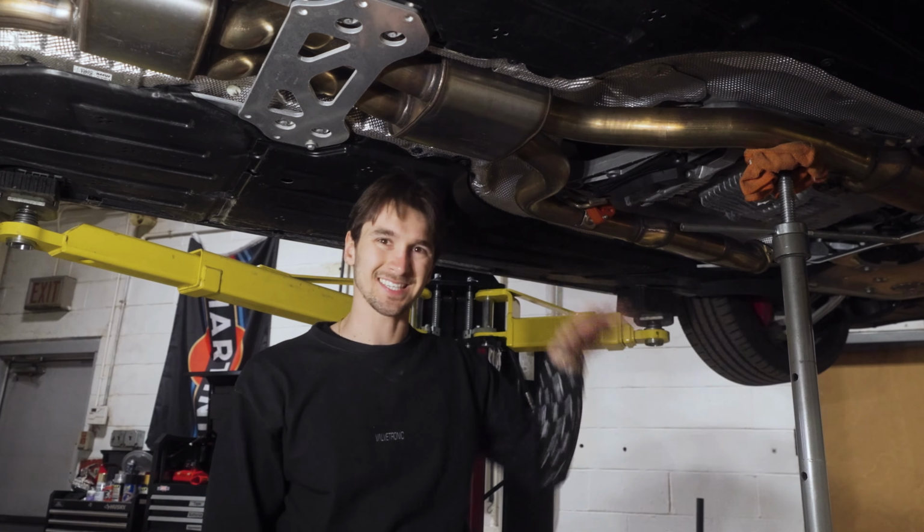And so now, if you want to come here, you can see there's even more space to bring the midpipe brace down a little bit. Now, there is the concern that saying this might harm the dynamics of the vehicle. This is such a minor thing. You can see the brace is about 1/2 inch down. Everything else is tight, and this is not going to cause detriment to performance or drivability whatsoever. So this is a possibility if you're not able to fit this midpipe or an aftermarket midpipe with the factory brace, so you are able to use spacers if necessary.